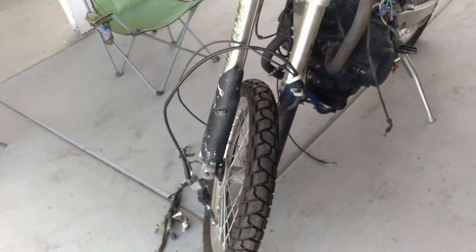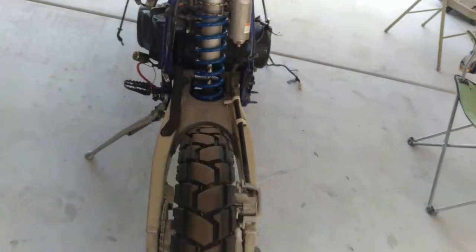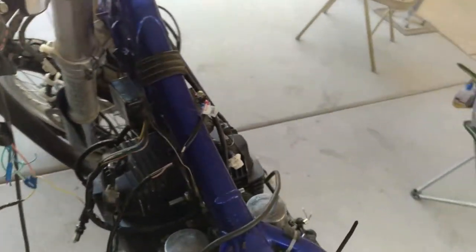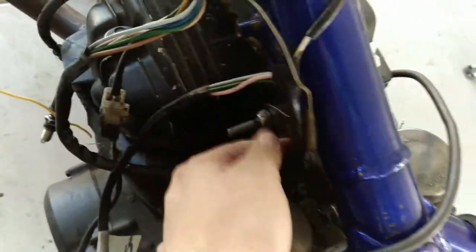Something I noticed - that front tire looks almost squared up, which is interesting. For any other WR owners out there, let me know if your front wheel isn't perfectly centered between your forks, because this is how mine has always sat. The spacers are on the right side and I'm not sure why it's not sitting right. The rear wheel sits perfectly centered, which is great, but I'll have to cut down some things like engine bolts or mounting bolts.